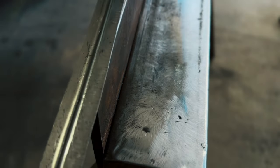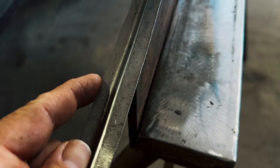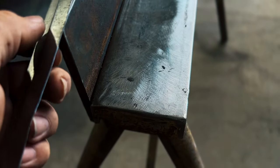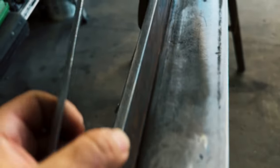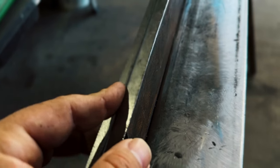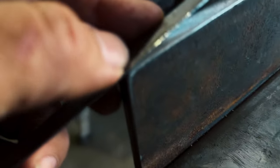So what I'm gonna do now to get that line to kind of curve out is I'm gonna go off dolly, which just means that I'm gonna hit just off the edge, not right on the dolly. I'm using this as a dolly, right? So I'm just gonna go off dolly, which means I'm just gonna hit that on the gap, basically.